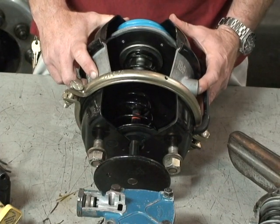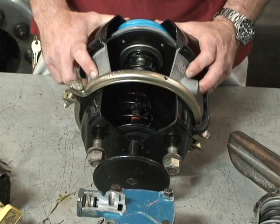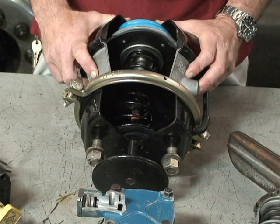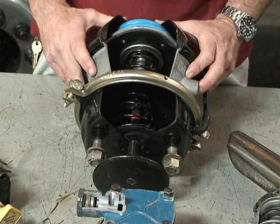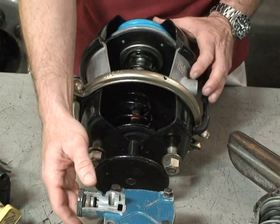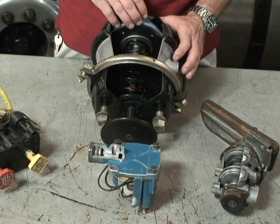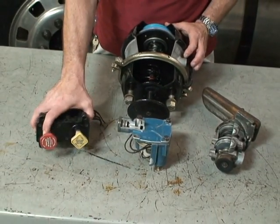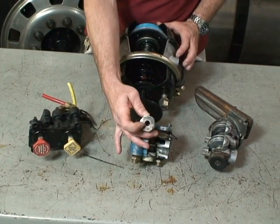So how do they keep the pressures to the safe working limit of 120 psi? By using an anti-compounding system. When we have an anti-compounding relay valve, we have this type of valve on here. This is going to control your parking brake circuit. So our yellow dash button will be connected to the service port on the relay valve.